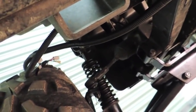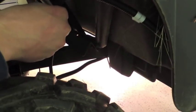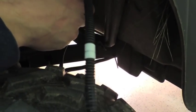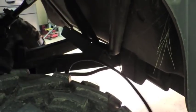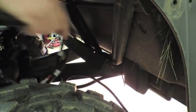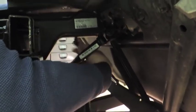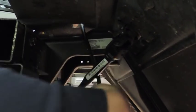At this point, make sure that all slack is up to the front of the cart so you have plenty of room to work with. Once you have the harness securely attached to the chassis coming up from underneath, bring it up to the front and top of the cart. There's a little trap door in the front of the RSV that will allow you to bring the cable through.